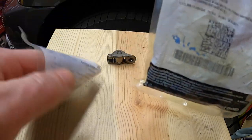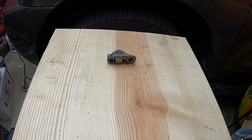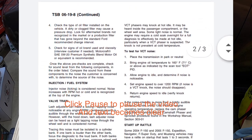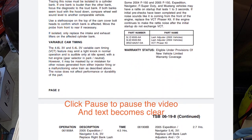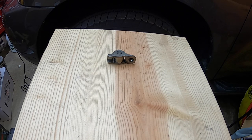Those are brand new parts from Ford — you can verify the part numbers for the bigger one and the smaller one. The rattling noise goes back to the history of the early versions of the 5.4 engine. Let me show you the TSB that Ford created — you can read it, you can search for it. The solution Ford provided includes: make sure oil meets specifications, make sure the API oil filter is not restrictive and meets specifications, and lastly the lash adjuster would have to be replaced if those things did not fix the issue.